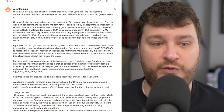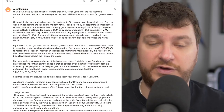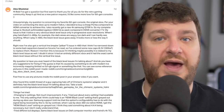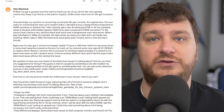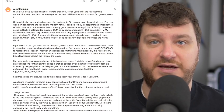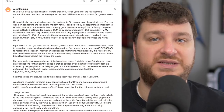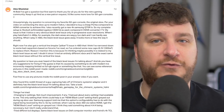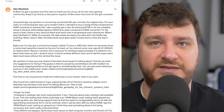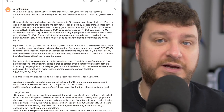Reading through what people commented on in the video, it seems like some TVs are able to manually switch what the black level mode is, and others are not depending on certain circumstances. The TVs that I use, you could just set the black level to whatever you want and you're done. Others, you need to set it to PC mode to force it first, because it goes by the EDID data the HDMI signal is sending out. And others, you just can't at all, because of the converter.